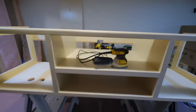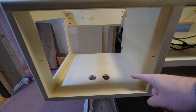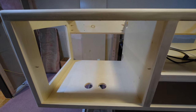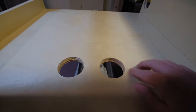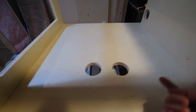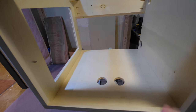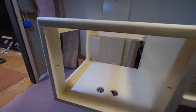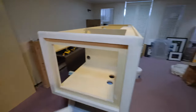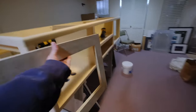It has the power conditioner, and we have holes in the back on both sides so the power cords can go to the components. The center channel cables run through the wall behind the rack. This side is going to be the AV receiver and amplifier - a 4-channel amp for the height channels. We put some big holes right under the bottom vents of the AV receiver so it can pull in fresh air from below the rack. With convection currents, that'll allow some heat to escape. We're going to do mesh or speaker grill fabric on the side panels.